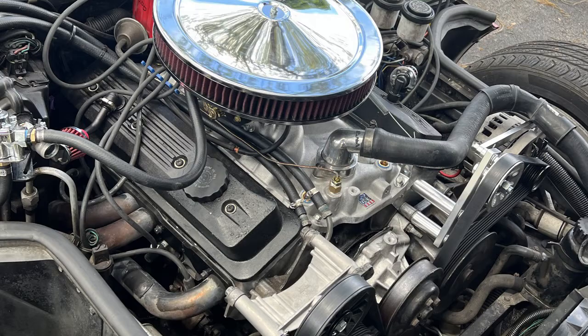This particular kit is good for 5,500 RPM. A lot of people say, why didn't you get the RPM intake? Well, because this is a stock bottom end, cast components, and to be honest I don't want to rev this thing past 5,500 to begin with, because it's probably not going to like it — between the valvetrain and the bottom end and everything.